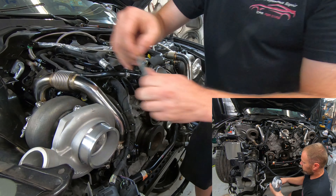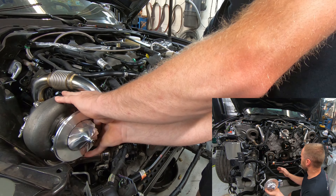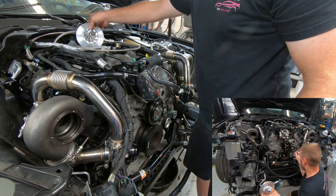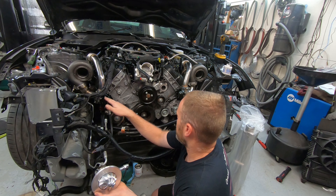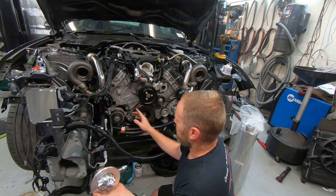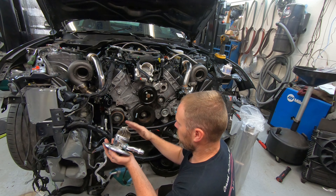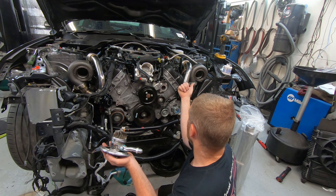I'll get all the lights and stuff taken care of as well, but that won't be until the bumper's on. I'm also going to start working on getting the cooling system installed. Here I am working with the turbos and trying to figure out the oiling. The lines that feed the turbos are kind of short — they include a Y, so I assume they want me to Y it to one union and then run it from there to the turbos. They're a little short and they'll string across the belt system, so I might replace those lines with something better.